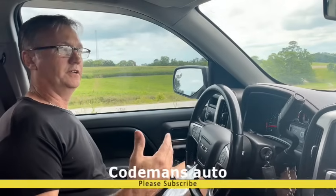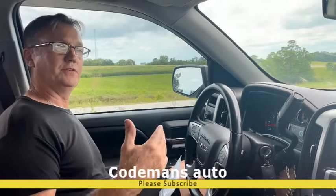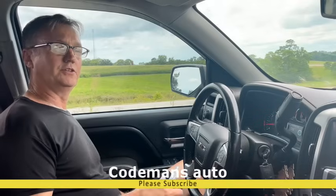I also want to cover a question I get asked all the time: if you live in cold weather where it's below zero in the winters, this delete is only going to allow the fluid to flow through the radiator the way vehicles have operated ever since the automatic transmission came out with coolers. Your coolant has been warming your transmissions up for years, and that's what it will continue to do. It's not going to hurt anything.